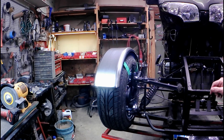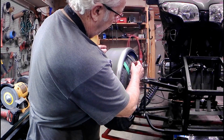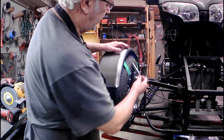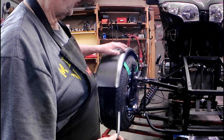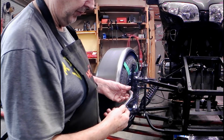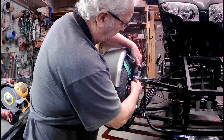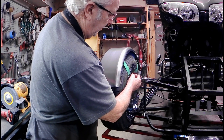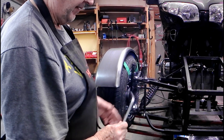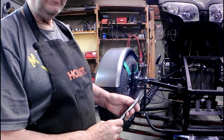I'm going to go ahead and get these guys ready. I've got to cut an angle on this because it sits up in here like this. It actually welds to this edge and up in here, so it doesn't put stress on this edge — if I just welded it right here, this would fracture pretty quickly; you'd see a lot of stress cracks. So I end up cutting this off so that I can weld it back in here, giving it a lot more support. There are two bolts that go in here, and I put a self-tapping screw down here too — it relieves a lot of stress on this joint. I've actually had my own bike break right here, at this angle. This is half-inch by half-inch cold rolled, so it's pretty strong.